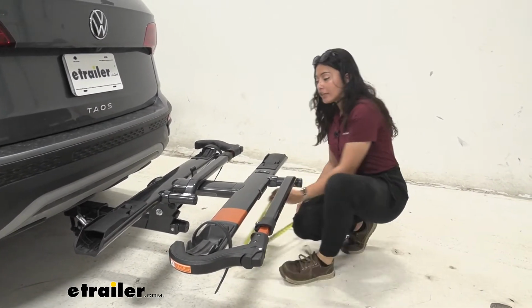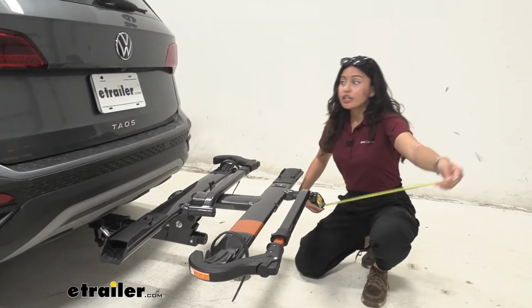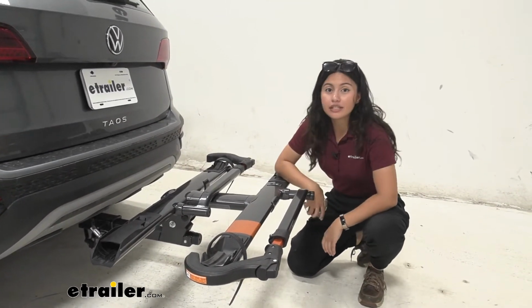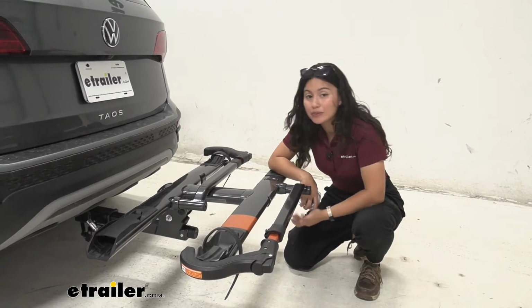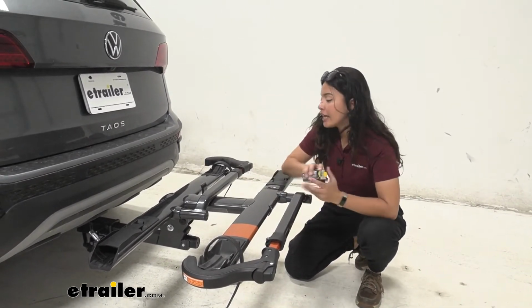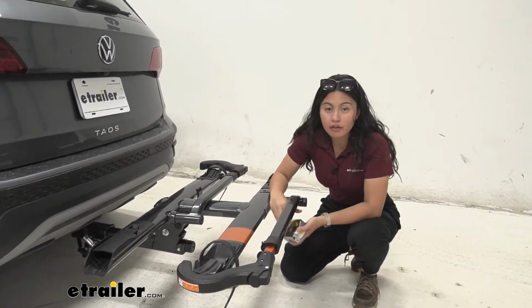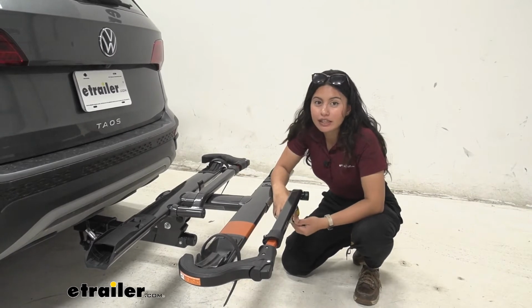Compare that to the shank though, and that's only 8.25 inches. So the shank, or I guess the hitch receiver on our Taos, is actually really close to the ground. So whenever you have accessories, please get something that has a shank rise like this. That way your bikes are staying higher up off the ground when you're going up those steep inclines